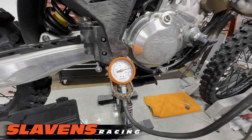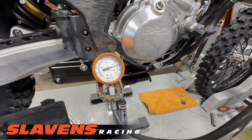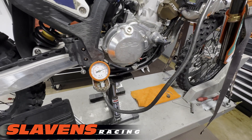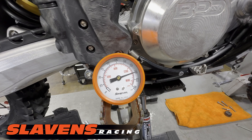It's really that simple. Screw in the gauge, make sure you have the correct length of threaded area on the gauge, hold the throttle wide open, push the button, and there's your end result: 200 psi.